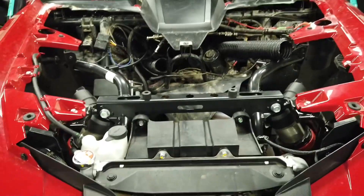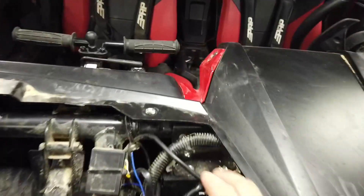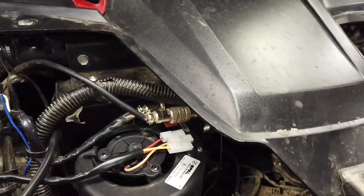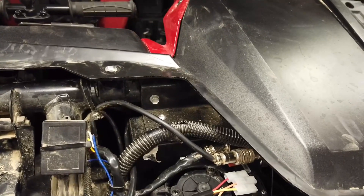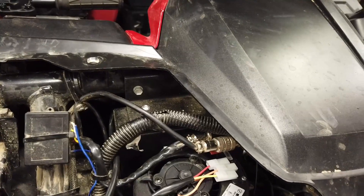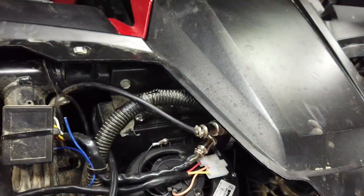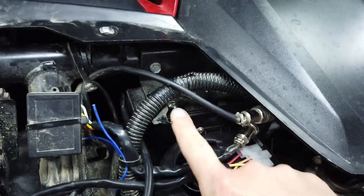The next step is going to be the blower motor and tapping into the coolant lines. I've got the heater unit itself mounted in place — you can see I've got a self-tapper there and another one a little bit further over. One important thing to note is that these self-tappers are the ground for the entire unit. If you try to test the fan motor before securing it, you're going to have to jump this ground wire or just go ahead and secure it to the frame, because the fan is grounded to the metal bracket which goes to the frame.